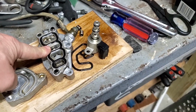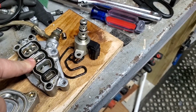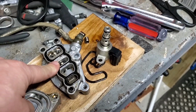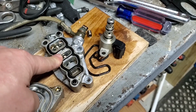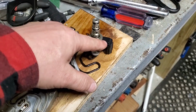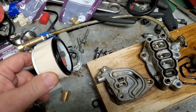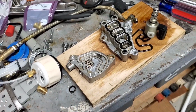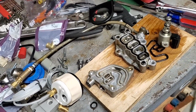And command the system to go into limp mode, and lights come on the dash. Okay, if that works, that's good. That's fine. But what I'm wanting to see is when it does immediately happen, I want to know what voltage is on this sensor. I'm going to back probe this here to make sure that's commanded properly and check pressure at the same time. Now, when I get this telemetry when it happens, then we can go further on what we need to look at. I don't know yet. I need to see what I'm getting.